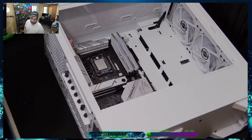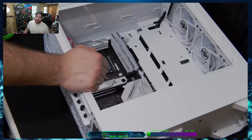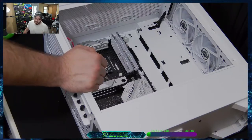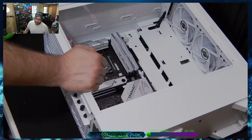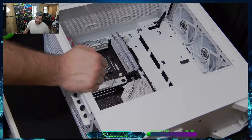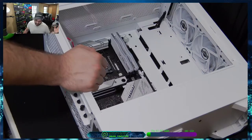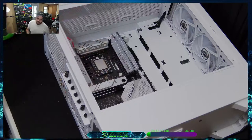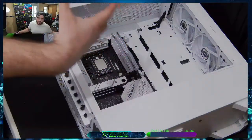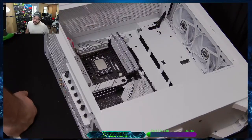I'm hardwiring into my PC, but not getting 1 gig like I should. So that could be a bandwidth problem on the ISP, not your router. Or you have a cable that can't support that speed, it might be an older Ethernet cable, or if you have a hub after the modem somewhere that's splitting off the connection, that could be the problem too. So it really depends, literally, from the cable outside coming into your house to the modem, what you have in between all of that, from the cable outside to your destination, which is your PC, that's what makes the difference. It goes modem, then router, then my PC. So it could be your router.